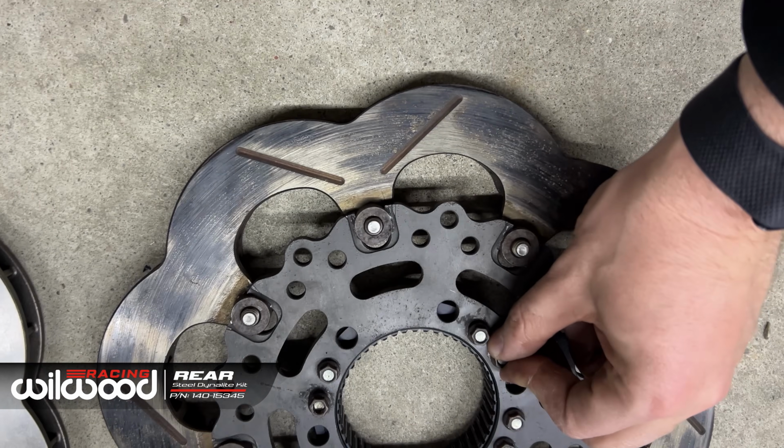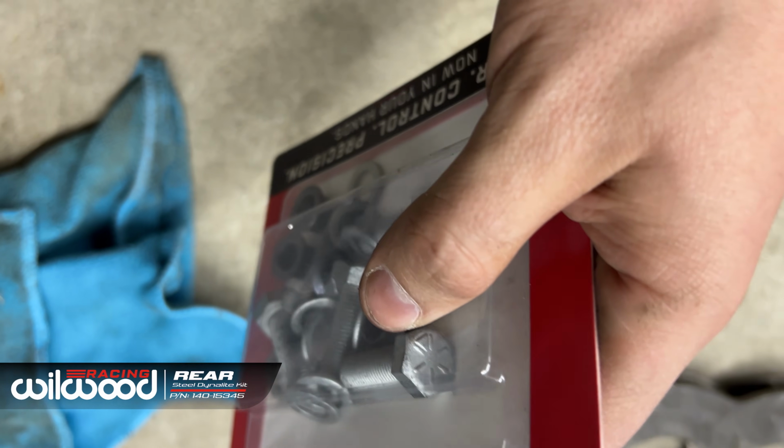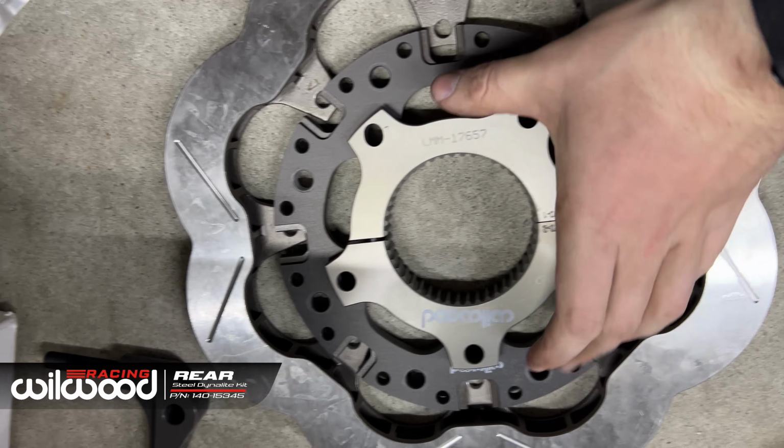These little jet nuts can wander out, whereas if you have just 3/8 bolts with jet nuts, like high tensile bolts, it's really going to be a lot more sturdy. So for me as an engineer, that makes a lot of sense. You're just reducing complexity of the assembly, and you're sort of beefing it up too with the bigger bolts. So keen to fit it all up. Let's see how it fits up.